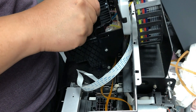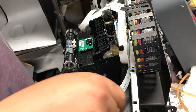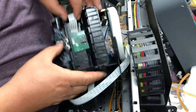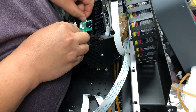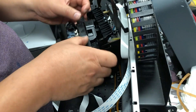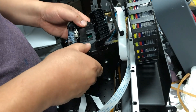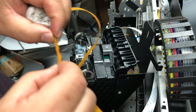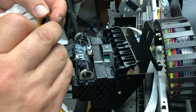Now it's part two — the installation. We put the real Epson board in. The new FFC cable is nicely folded and threaded through the carriage return and plugged in. Because this one doesn't have a PW sensor, I just leave it empty — you don't really need that sensor. In your RIP software, just uncheck page width detection and it won't read that sensor. Now we put the cover back. For the belt, one side has teeth and the other side is smooth.